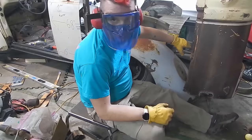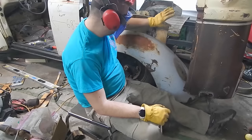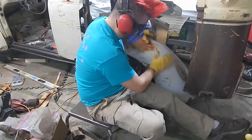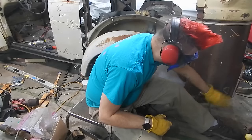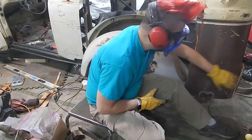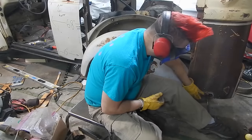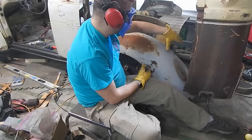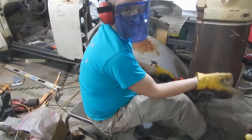That does it. It's all needed because I removed the back half of the wheel well that would go inside the engine compartment. I'm going to use the fender to fill in that gap on the inside, and then the curve on the outside. The bottom of this is lower than the bottom of the bug and I'm gonna have to get a new corner anyway because it's completely rusted out. These are not gonna be the tail lights — I've got some early sixties lights for it. So I'm gonna cut here to make this fit so I can bolt it in place, make this all roll in, and then make a cardboard mock-up of all the metal pieces I'm gonna make for the inside of the engine compartment.